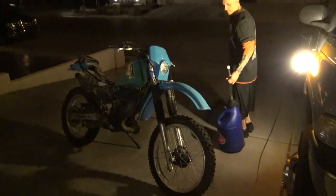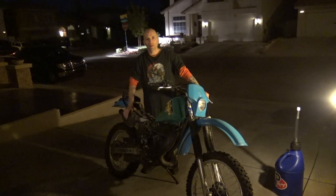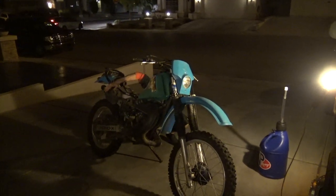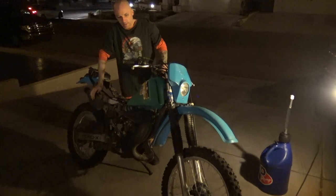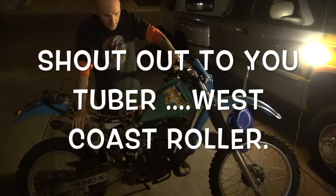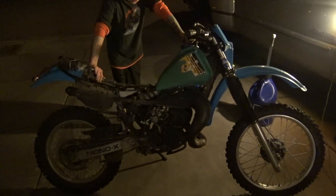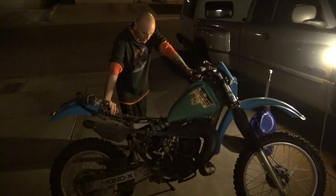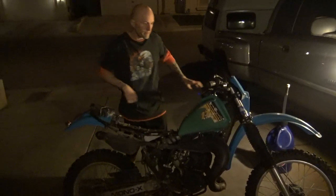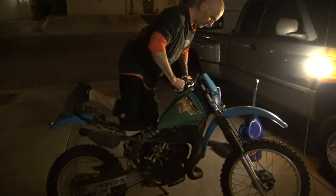It's recording right now — it's the moment of truth, folks. 1982 IT 175, we're about to bring history back to life, hopefully. It's on a brand new plug. My friend here helped me clean out the carburetor and the main jet — you could barely see any light coming through it. We had a small problem with the float sticking, but it seemed to have fixed itself. We have a makeshift air filter on there right now, not properly, but it shouldn't affect the initial start-up. Let's see if we can get her to sing.